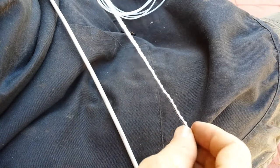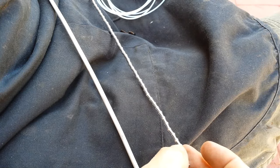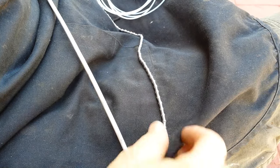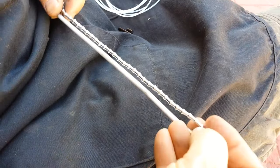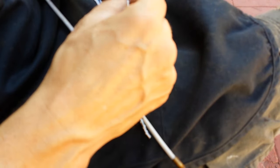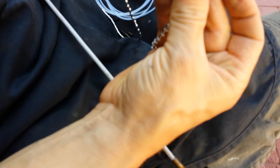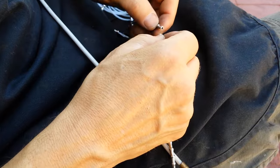Number three, it's more durable. This aluminum housing will last a lot longer and will not degrade like conventional housing does. And lastly, it's easier to install. You don't have to have a special housing cutter or struggle with wire cutters. This housing simply pops apart using your fingers — you adjust to the desired length and pop it back together.